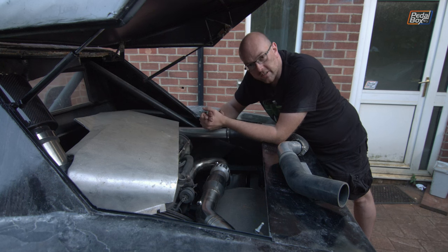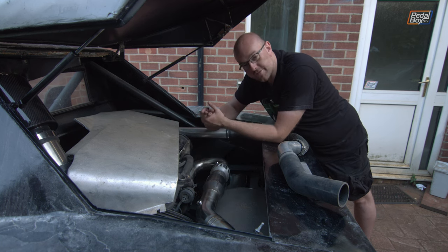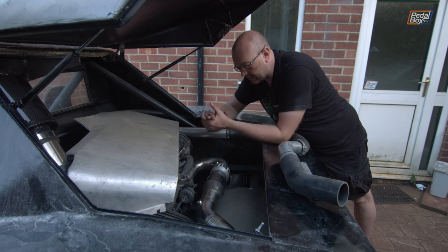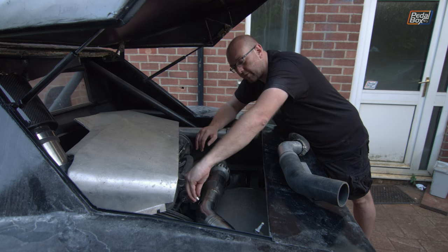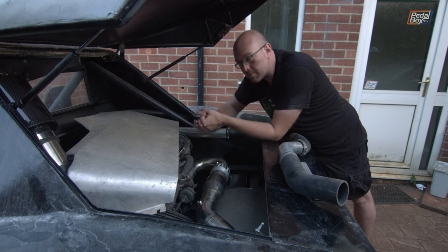There's a lesson relearned — stainless steel is very hard. I've pretty much burnt the step bit out drilling this hole too fast on the drill press. It was fine through four, six, eight, ten mil after the pilot hole went in, but getting up to twelve and fourteen it really started to get unhappy. I slowed the drill press down and got it working through to about 20mm, but even 22 was a real challenge, so I had to finish it off with the die grinder and a file. These are a nice fit now — this one is an extremely nice fit, and the other just has a tiny amount of play. We can send this off to get welded in, and then I'm going to move back onto the dashboard.